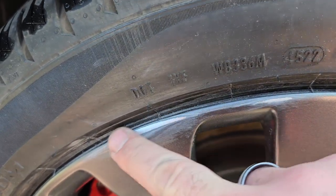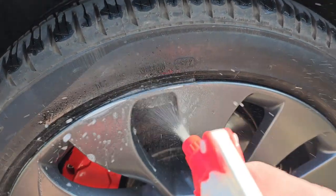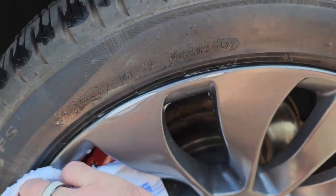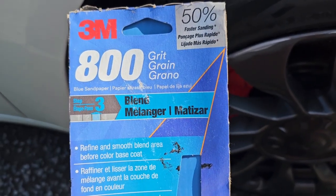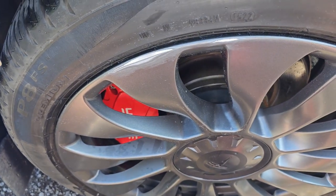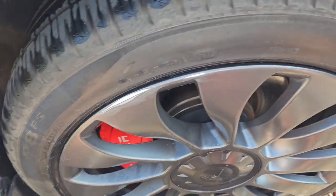I was just trying to smooth this out and get the major gouges, because it needs to be smooth otherwise we're gonna see it. Next I'm gonna spray it with just Dawn soap and water, wipe it off, get it nice and clean, and double check that it's smooth. Then we're gonna do an 800 grit dry sand to keep smoothing it out.